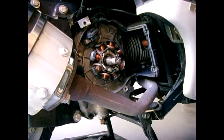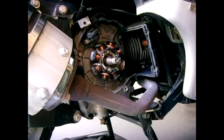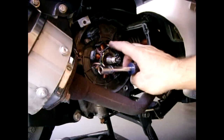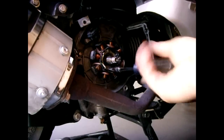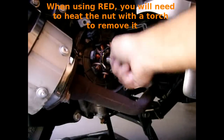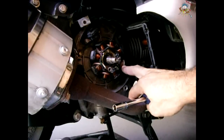The next step is to remove the two bolts holding the stator. Going to remove the stator with the ratchet. The windings look nice — they're not burned, nice bright copper. When I put these bolts back in I'll usually use some Loctite blue medium strength, and when I put the nut back on the flywheel I'll usually use the red. Take notice where the one different coil is — this one has tape wrapped around it and it points forward, so when this goes back in make sure the one that's different points forward.